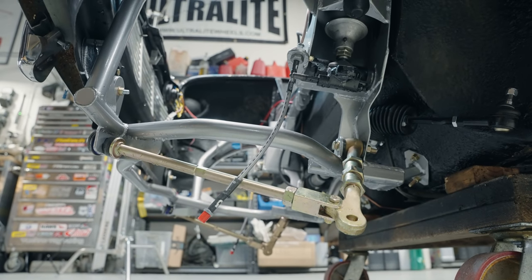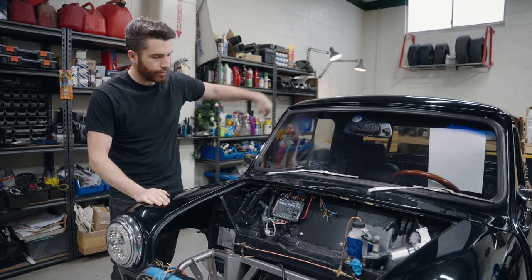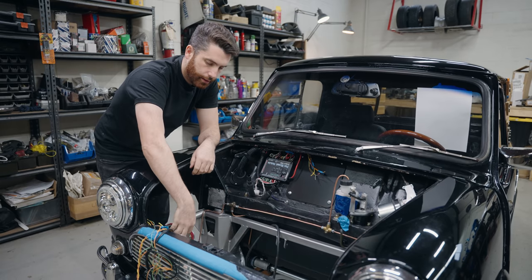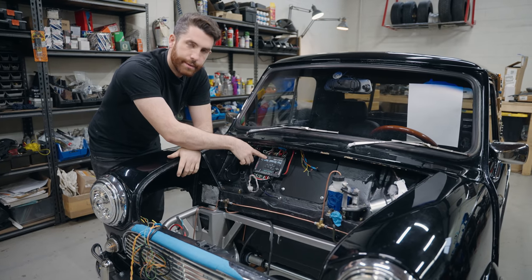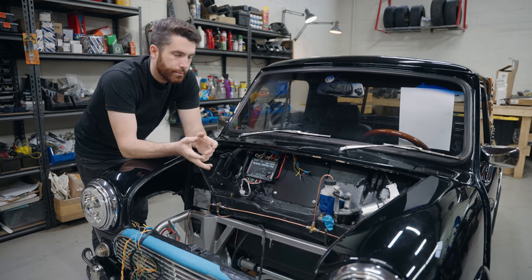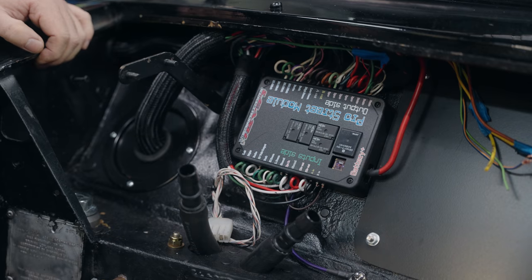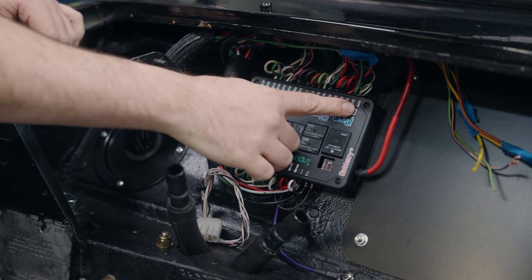Following along from the back, we've got the battery cable. After running to the amplifier, it runs all the way forward and comes out here. We haven't finalized its placement yet. This gets attached to the starter, and then there's this big thick battery cable that runs up and powers this piece here. This is sort of our chassis computer — this is what controls everything on the car. We've got a battery positive input into here that's circuit protected, then it's distributed to all of the outputs.